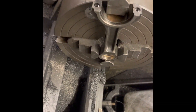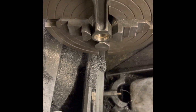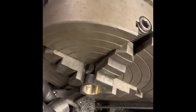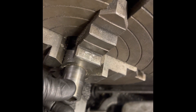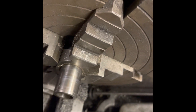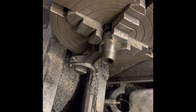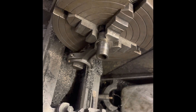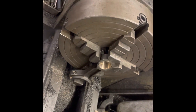We've got to use these rods because they match the TDI direct injection piston. What I had to do was put it in the four-jaw, push the old remains of the old bearing out, push the new bearing in, and then bore it. The pin goes in nicely. It may tighten up because the clamping forces of the jaws on the little end housing may distort it slightly, so it might need finish honing to get it perfectly round again. But that bit is done - the pistons and rods assembly can go together.